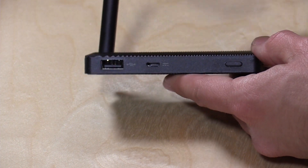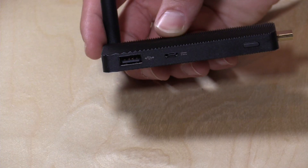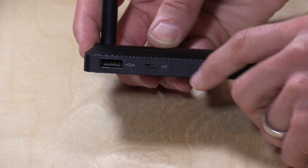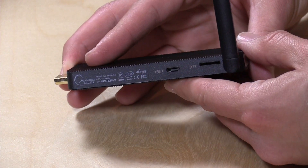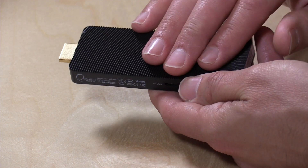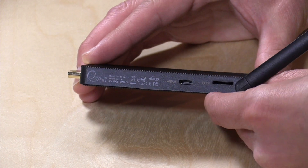It's got a full-size USB port for plugging in a keyboard or mouse or both. I would recommend using a powered USB hub if you're going to plug in other devices, just to keep the power flowing into the device itself, because it's only taking tablet power — essentially two amps of USB voltage into the power port. The power switch is on this side. Over here you've got an additional micro USB port, so you need an OTG adapter. There's also a micro SD card slot to augment its internal storage. It's got 32 gigabytes of onboard storage and two gigabytes of RAM, powered by an Atom Bay Trail processor.